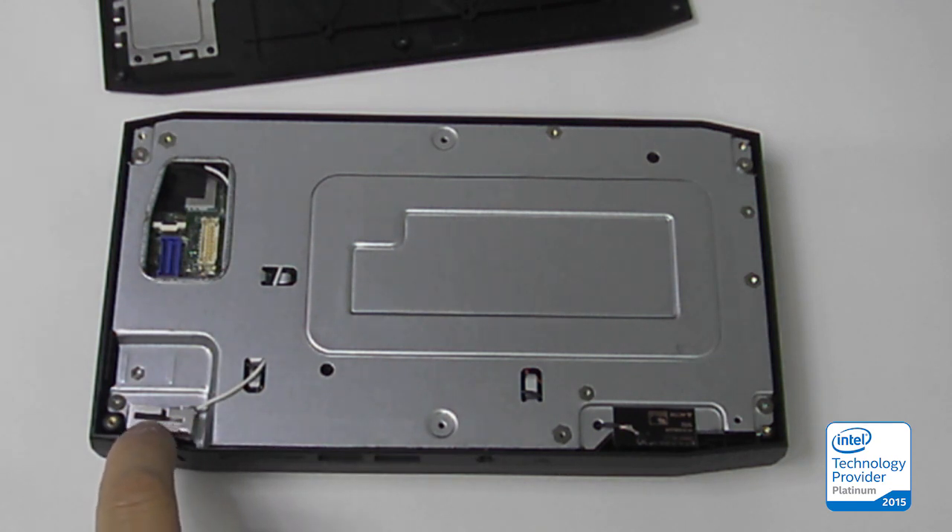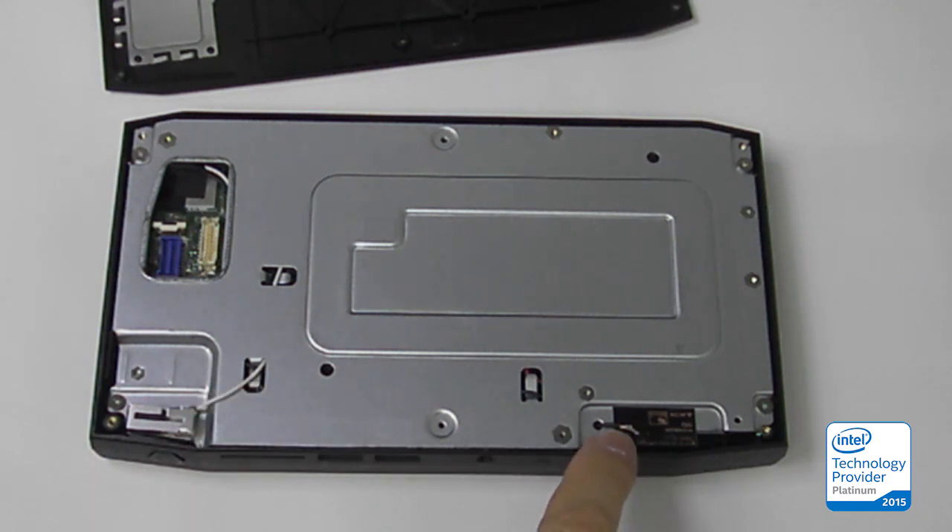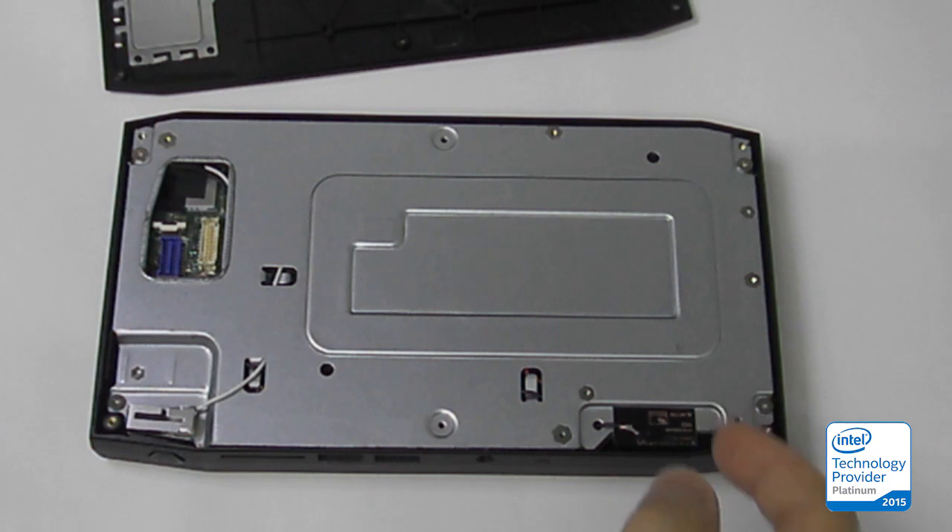We also see there's a wireless antenna — this is a tuned antenna design. And then over here it looks like a PCB antenna. This is a coax, and so it looks like this might be for Bluetooth, or this might be a secondary antenna, but it's a PCB style, most likely stuck down with double-sided tape.